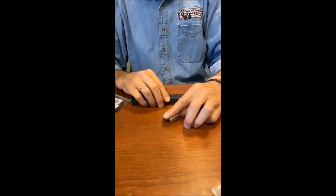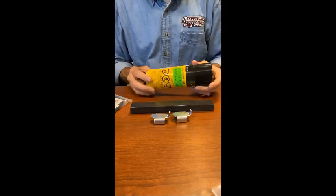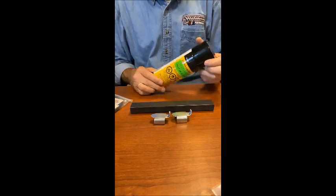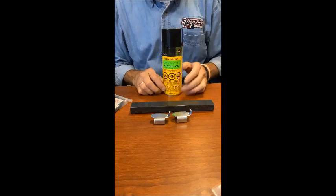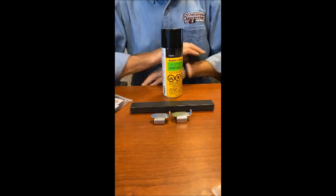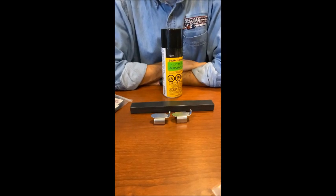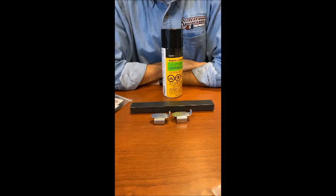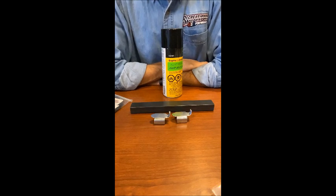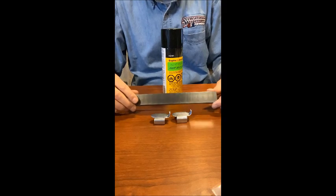First thing we have in front of us is track clips, graphite Hi-Fax, and we also have a graphite spray. We buy this from John Deere, but we sell it. It's probably one of the best sprays on the market. Okay, so what do the Hi-Fax do for me? Well, you have plastic Hi-Fax currently, and if you have a big sled, you realize that if you're riding in any kind of limited snow, the Hi-Fax will start to stick to the clips. So we go to graphite, which reduces that tremendously.